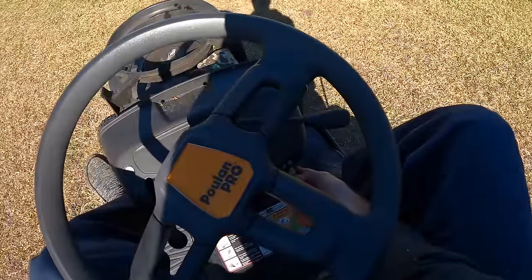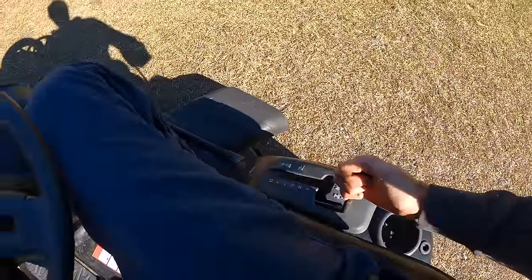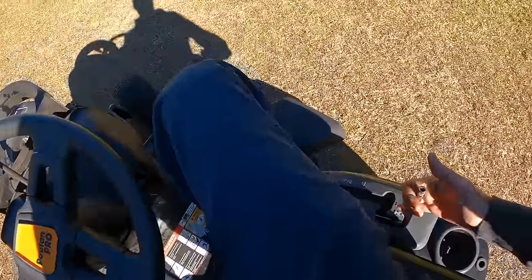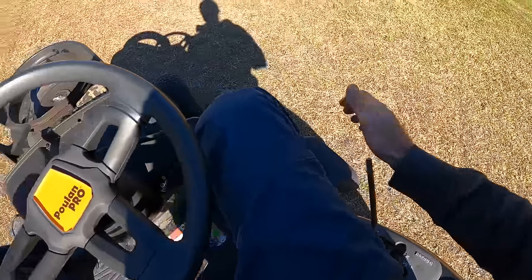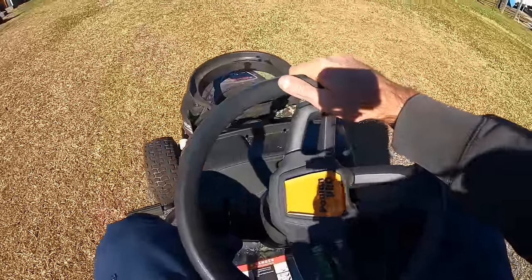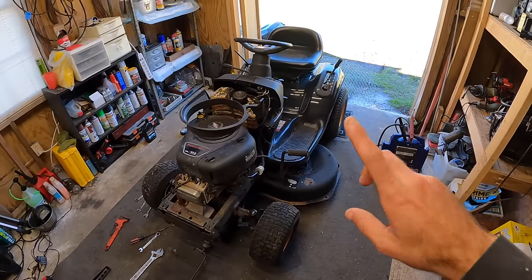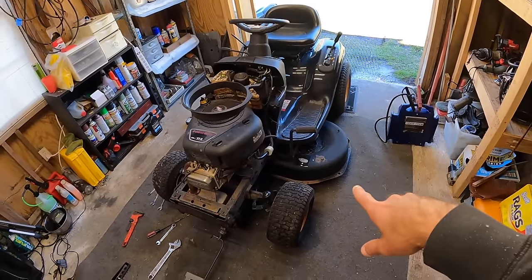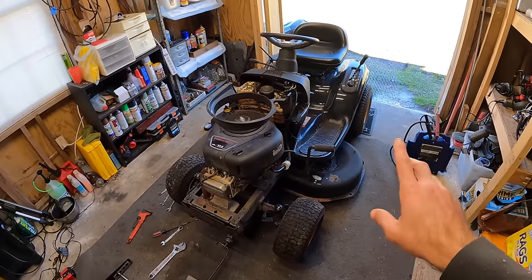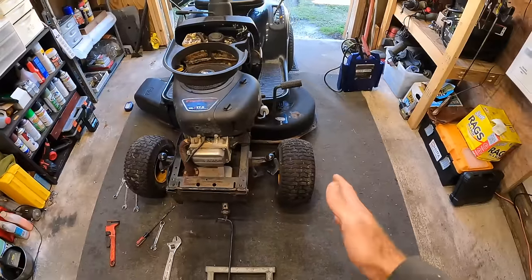Let's see if the reverse still works real quick — oh yeah, yep. We got this back into the shop and I am very pleased. We got transmission working, reverse working. We were able to verify that the deck engagement does work. I know the blades are shot and I think that's what's causing the vibration. I'm going to pull the deck off anyway because I want to clean it, grease it, and repaint it. I didn't put this back on the lift because I want to do the alignment now.